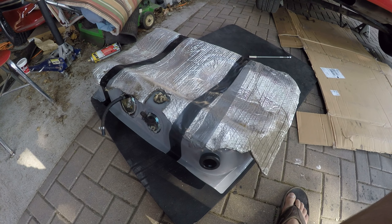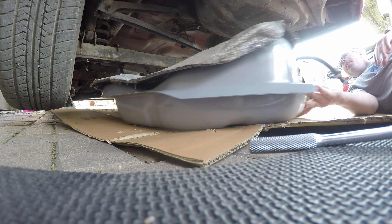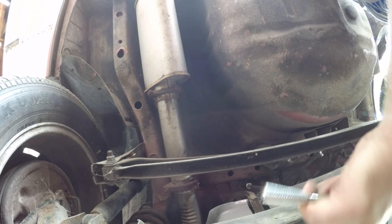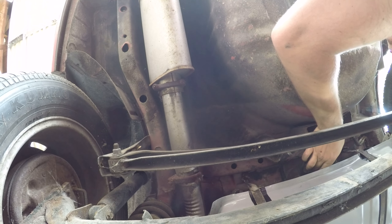I slid the tank under the car on some cardboard and then used the jack to lift it up — make sure not to crush it on the way to the top. It really helped to have the tank totally empty on the way up. From there, you just need to hook your fuel lines and connectors back up after securing the straps, get the four screws for the filler neck in there, and you should be all set. Thanks for watching. Remember to check out the Shelby Dodge Automobile Club at www.turbo-mopar.com and post up in the comments if you have any questions.